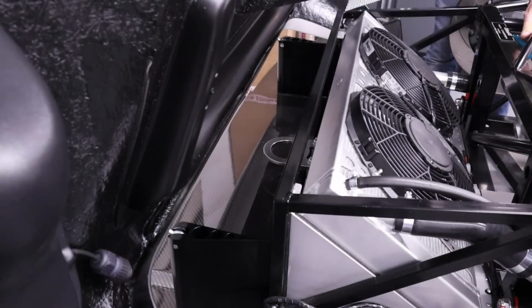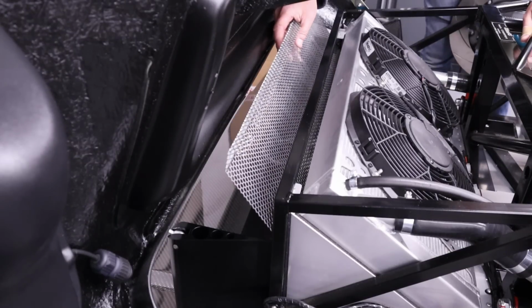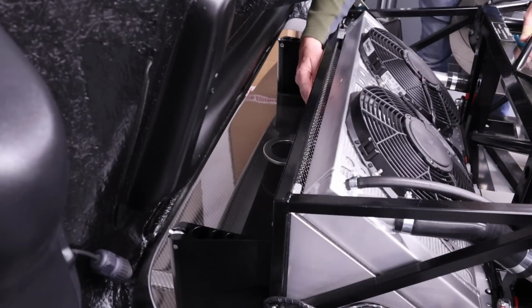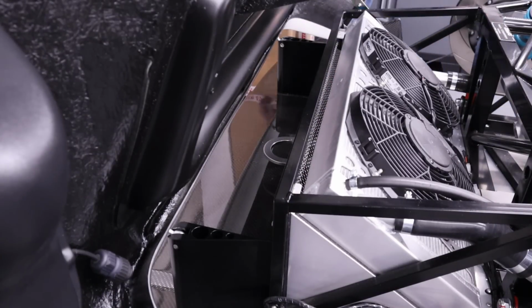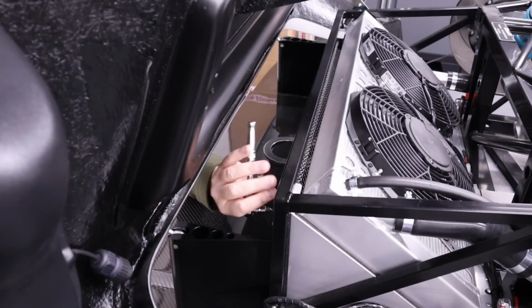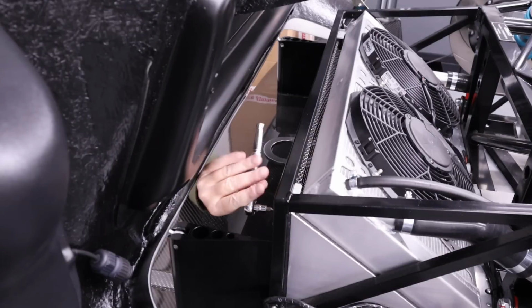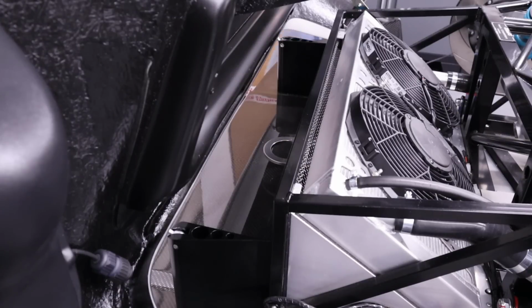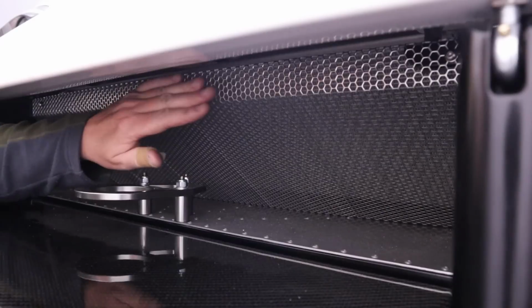So now we have drilled and tapped the two fixing holes. I've taken the tape off this and I'm easing it in very gently so I don't scratch anything, and we're going to put it on permanently. There it goes, sitting home. Right, I'll get underneath now. No need to over tighten them because you don't want to pull the threads, because it's only going through about 3mm steel. There we go. And here it is in place, looking good.